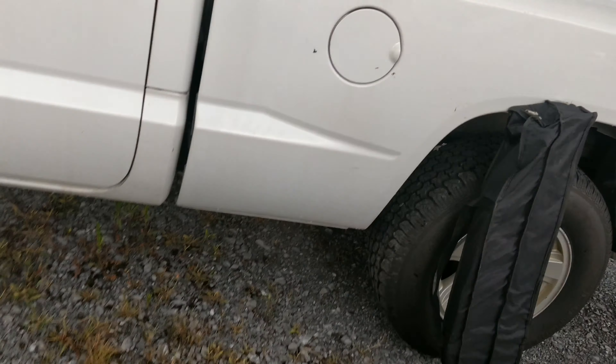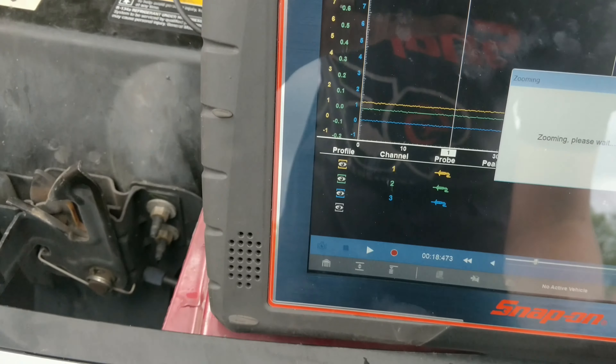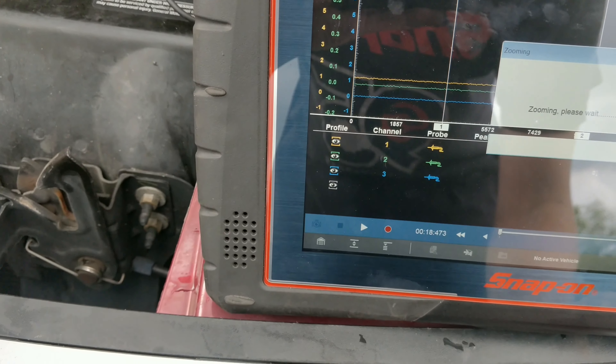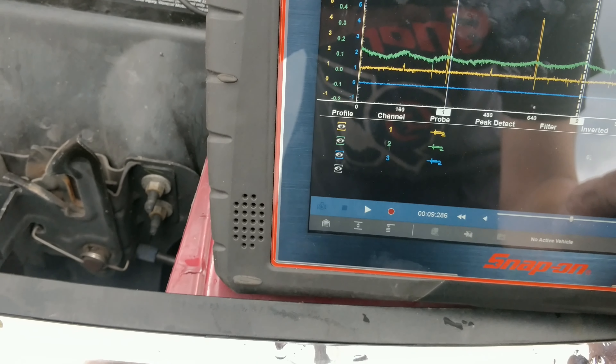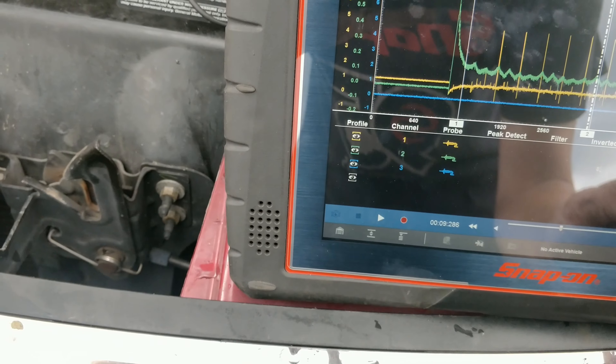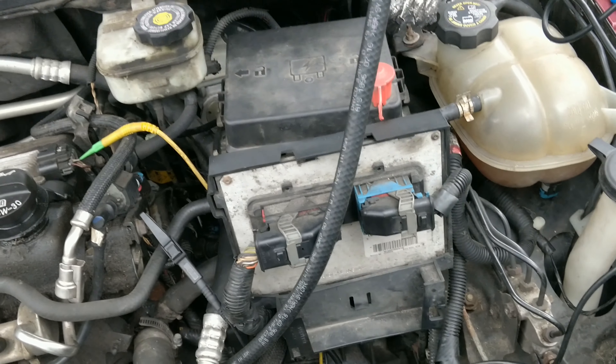This chain must be really loose or something because it seems like the pitch of the engine cranking changed. Still nothing on the pulse sensor. I wonder if this lead is bad — let me see if I have another lead; I always have issues with these.